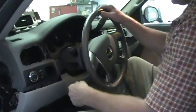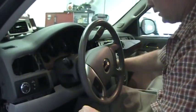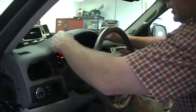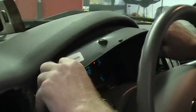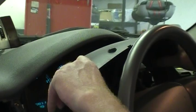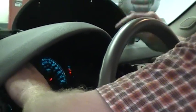You're going to want to tilt your steering wheel down, have the key in the ignition, and put your gear shift selector down. Now that those screws are out, this trim panel bezel will come out. Work it out of there and remove it out of the way.